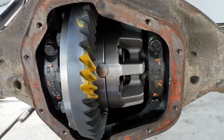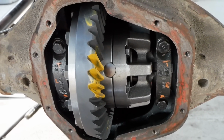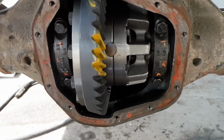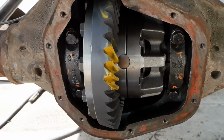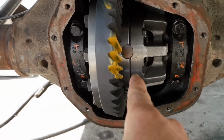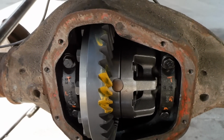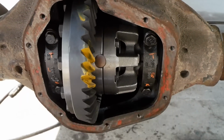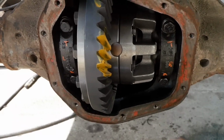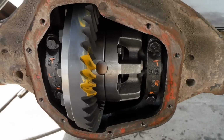So now you've got to tear it all back apart, pull out all the bearings that I sanded down, because we need to be able to remove them if we had to add shims, remove shims, and whatnot. So, remove those bearings, press the new bearings onto our carrier, reinstall everything, double check everything for the 80th time, torque the caps down, put the cover on, call it a day.